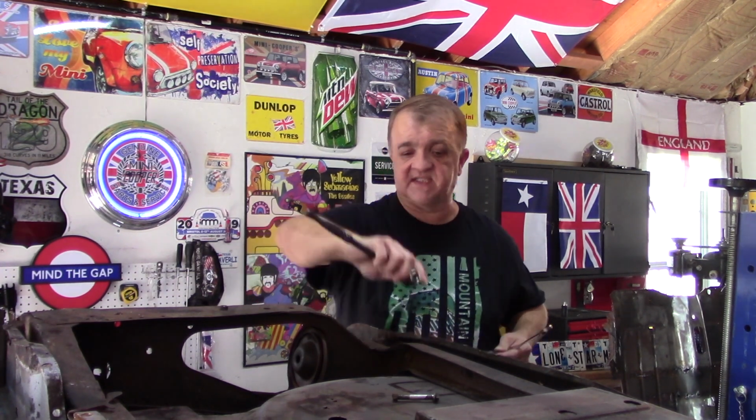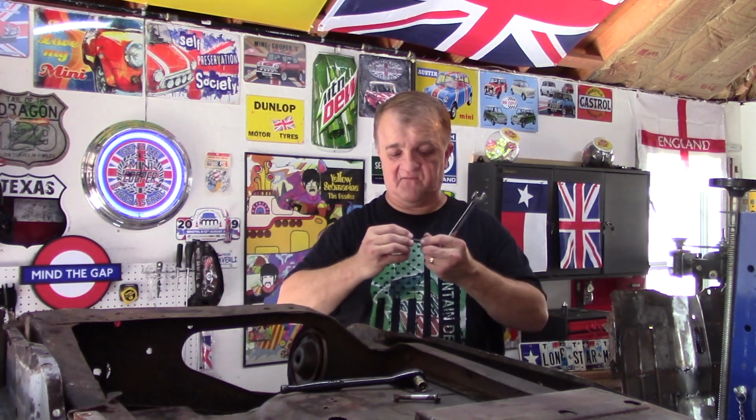So if I can get this bolt out, there's two here and there's two on that side. The plan is I'm going to compare the new Magnum heel board to the existing heel board. What I'm looking for is hole pattern matchup. Right now, I'm not cutting anything out. I'm not removing spot welds or doing anything. I'm just going to play it safe and think.